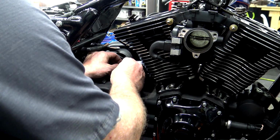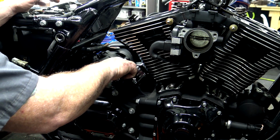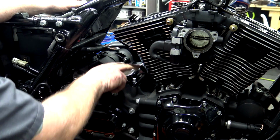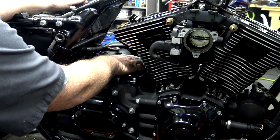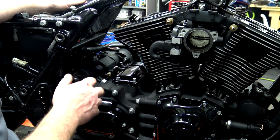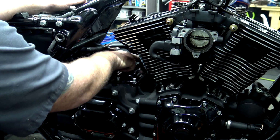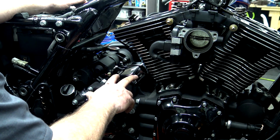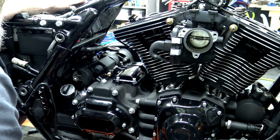So I just do the front side, lift it, make sure I'm going through the gasket into the hole, not pinching the gasket. Now you know the rest of it's pretty well lined up. So what I'll do is run these in, and of course I don't really have anything to get torque on these front two up here, so I'll torque these down with my torque wrench, kind of get a feel for what you're doing, and then you know how much pressure really gets you in the ballpark on these front two. I don't really have anything to get my torque wrench in there to get those very good, so just do these first, do those last, just kind of get a feel for it and try to get in the ballpark there.